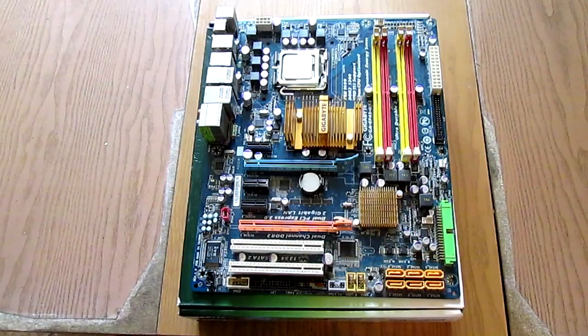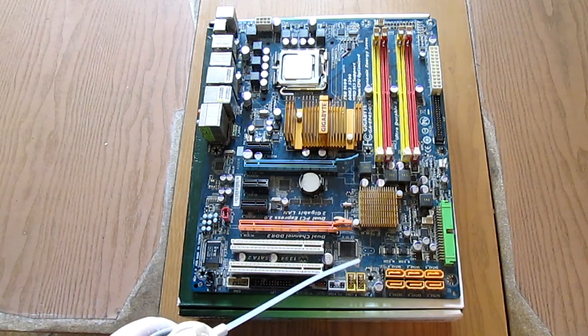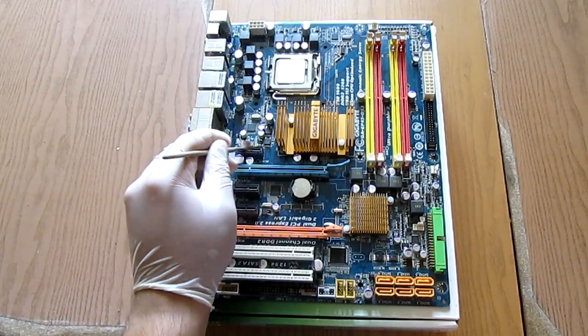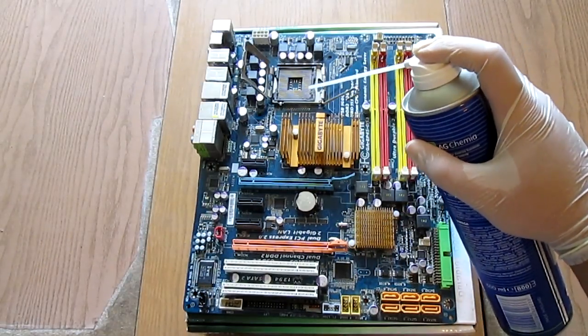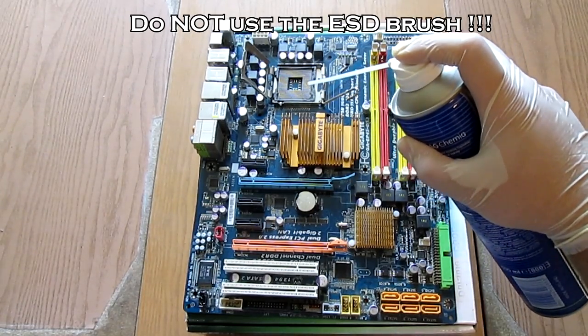Now I'm going to start cleaning the ESD-sensitive components. First, let's clean up the motherboard. Mount the protective plastic cover on the socket — this way larger chunks of dust won't be able to get inside. If you don't have the plastic cover, simply leave the CPU mounted in, like I have. Then take the can of compressed air and do a sweep of the board. Check for spots with leftover dust and take the ESD brush and gently begin cleaning. Then do a fine sweep with the compressed air. After that, remove the plastic cover or the CPU from the socket and gently clean it with the compressed air, but do not use the ESD brush.